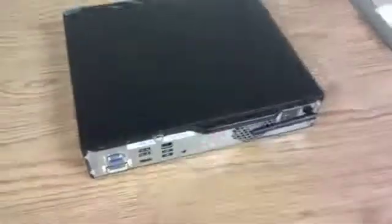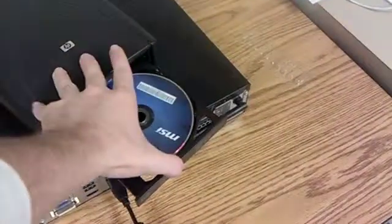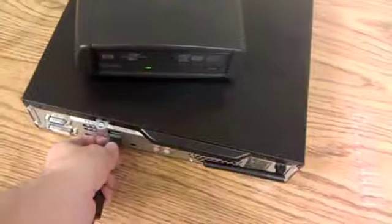We're ready to load the operating system. The way I've been loading the OS on these is using a portable CD-ROM connected via USB cable. I'll boot up off USB, format the drive, get the SSD all set, load the OS and drivers, then detach the drive, and it'll be ready for deployment.